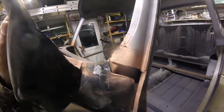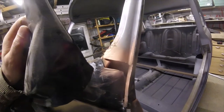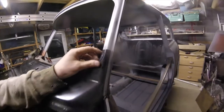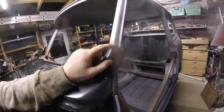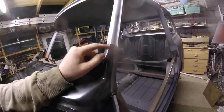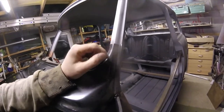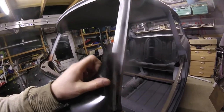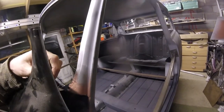This is the bit where we've got chops on, and this is the bit where there's still quite a bit of corrosion up this A-post. Luckily you get quite a lot with these heritage scuttles, so it actually comes all the way up to there. Although oddly it's not quite a straight line — probably because it's straight before it gets pressed and then the different angles it's pressed into make it slightly curved. We'll mark roughly where that's coming to and then remove most of it up to here.